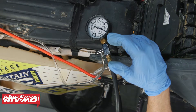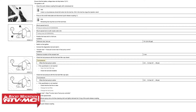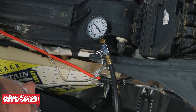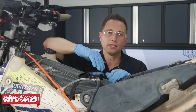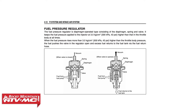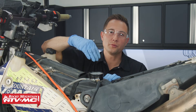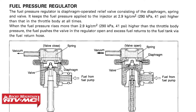Ours is dropping a little bit, so at this point we need to run the bike and make sure our fuel pressure is within the specified range. Our bike should be 41 to 46 PSI, and it should consistently stay in that range even if you give the bike some throttle. When we ran our bike, the pressure was right in spec even when we gave it throttle — so we're looking okay on pressure. But if your pressure was too high, that indicates a bad pressure regulator, typically found inside the fuel pump, and you'd have to replace the whole pump. The symptom of too much pressure is the bike running rich. Some pressure regulators are mounted outside the fuel tank — if that's the case, check the return line for restrictions and the vacuum line going to that regulator; if both check out, you'll have to replace the pressure regulator.